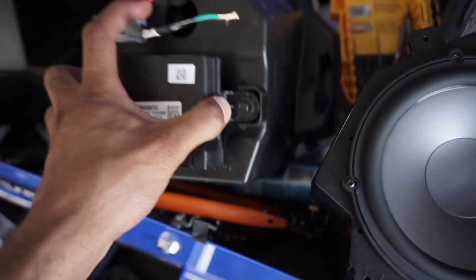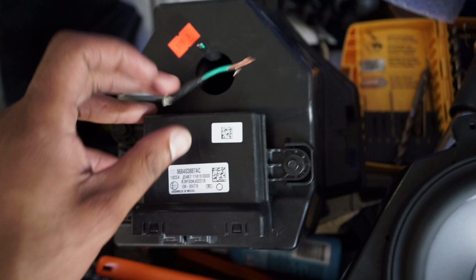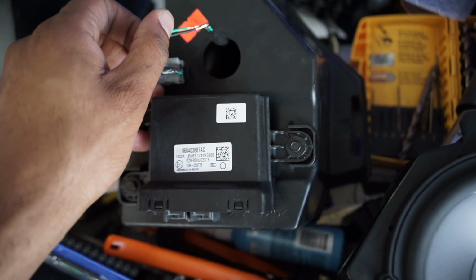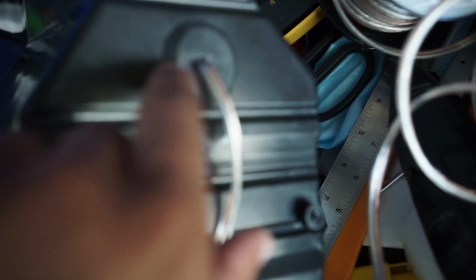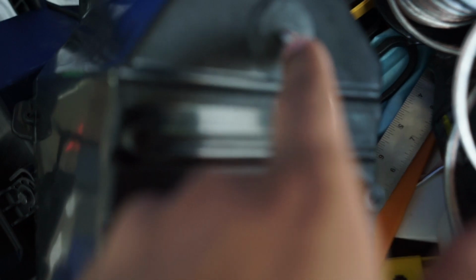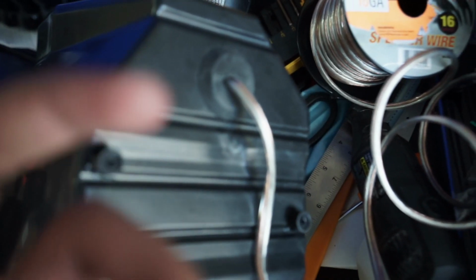But what you want to do as far as with the driver's side only, you'll have this grommet right here with the wires that go into it, and it plugs up that hole, and you have this hole right here. So you want to take that grommet off. I just cut the wires and pulled them out, and then fish these wires through. Well, I tried to fish these wires through. It was hard. So what I did was take it, and there is a line that goes straight across. I just took it and split it down the middle until it got to the intersection, the center. Sprayed it open, put it on, clamped it, and pushed it back through, so it still works. It just was the easier way to get the wires through. But you want to put that grommet on, and then you have this part right here.